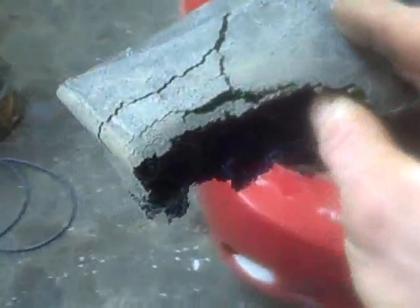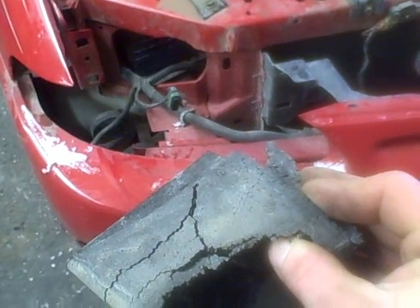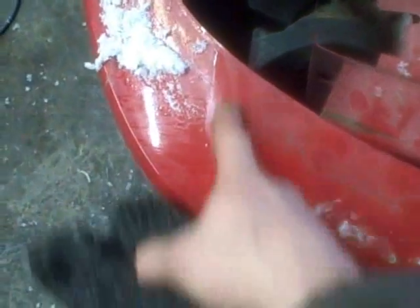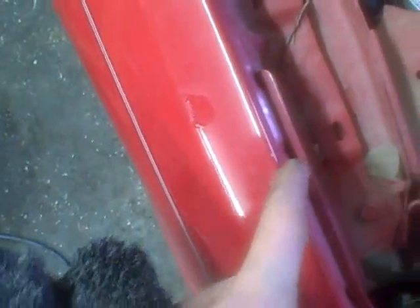What I've done so far is I got to pushing down on this bumper and a piece of the bumper pad came out. What these bumper pads are designed to do, aside from supporting the bumper, is to absorb an impact from the front — they're a real dense foam. So when you hit something, it'll squeeze together and crush. What happened is it's crushed and broken, so when I started pushing on that, the whole thing just dropped out of there. I think we'll just leave this piece out and try to get things straightened up, maybe with a little bit of heat on the bumper. It's going to need a new bumper shell anyways.